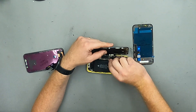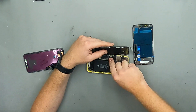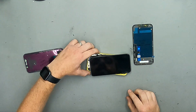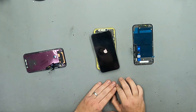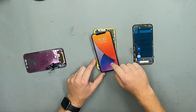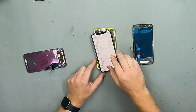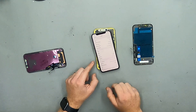I'm going to disconnect this now and reconnect the original screen, so when iOS boots this time it will find the unique serial that it's coded to look for. The notification will pop up very briefly on the front of the screen — there we go — and then it will disappear. If I go into Settings > General > About, there is no display message there. This iPhone is on iOS 14.7.1, which is the latest iOS 14.